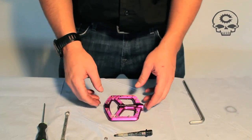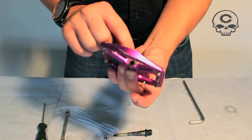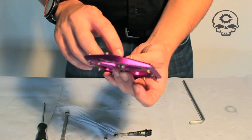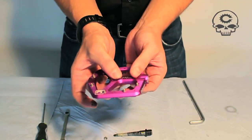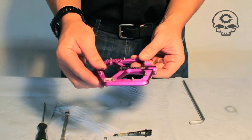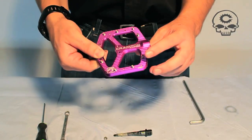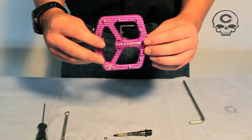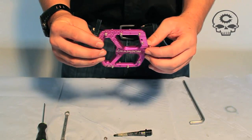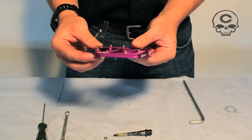As you can see, it's really greased inside. Our pedal here has a DU with a hat on this side, and another one over here but smaller. There is also another DU underneath that does not have a hat. If your pedal has a lot of wiggle — side to side, up and down — these DUs have Teflon coating, and when they spin, eventually the coating wears down and you get down to the brass. The brass will run and wear for a long time, so no worries if you have a little bit of wiggle in your pedal.